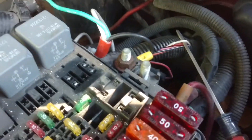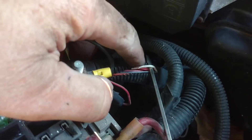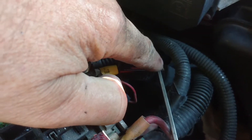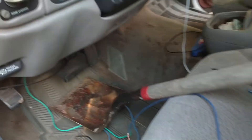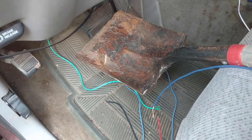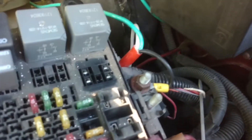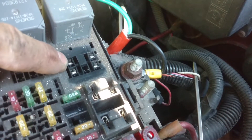This works the same for GMC 98. The best thing you can do is loosen this up and move it out of the way a little bit, then open this wire loom and check that white wire for voltage with the brake pedal pushed. I have a shovel here just to hold it down — that's enough to get the brake light on — then check it for 12 volts.